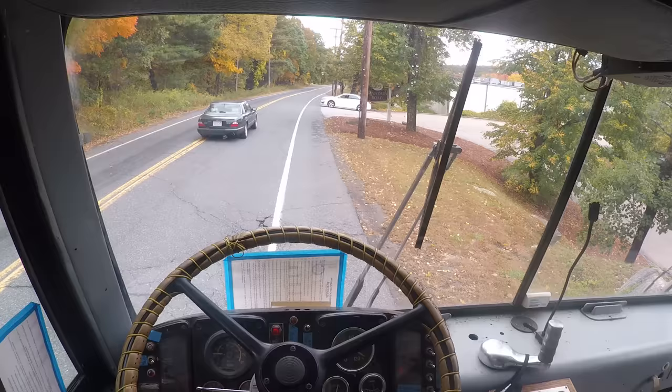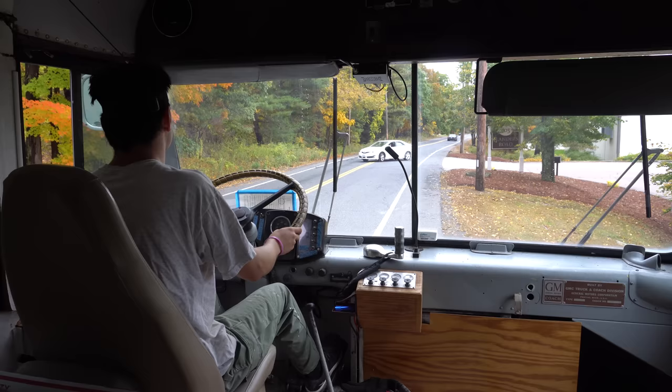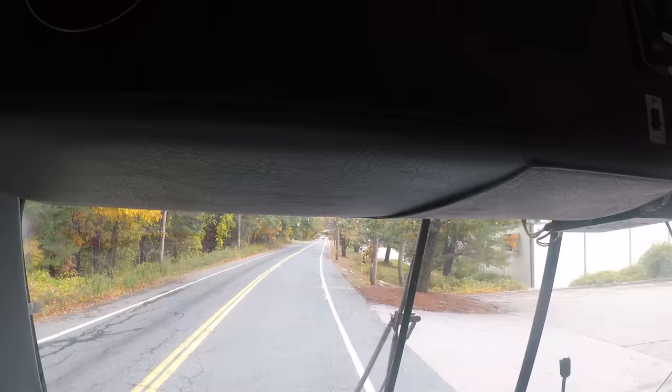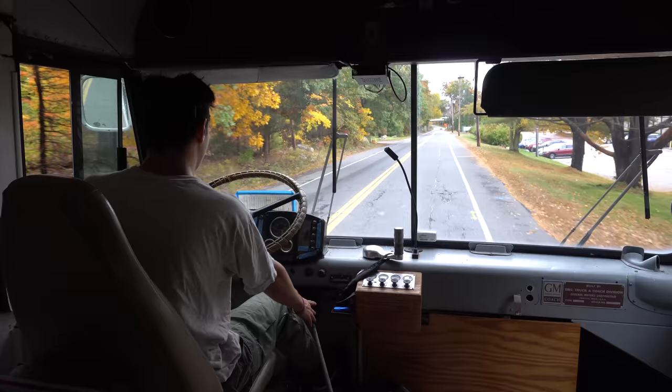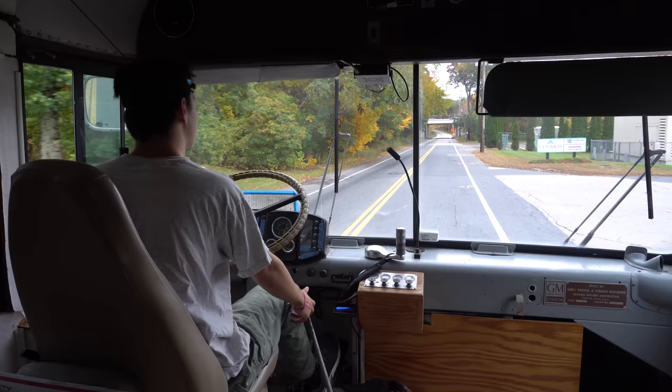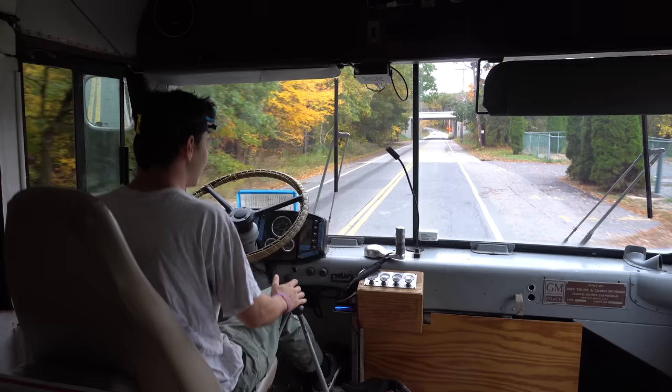Brakes off. First is a very short gear — I'm already at the top of first. But this is not a synchronized manual transmission. To get to second, I'm going to clutch in and hold it in neutral for a few seconds, then lightly bring it back. See how it's grinding — that's not good. Back to neutral. There's second. When I say it's not synchronized, it means you can't just go from first back to second and expect it to stick, because the gears have to line up. They're not synchronized for you. It's '60s technology.